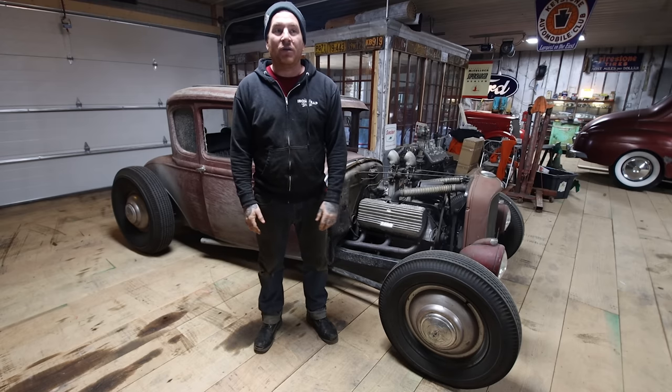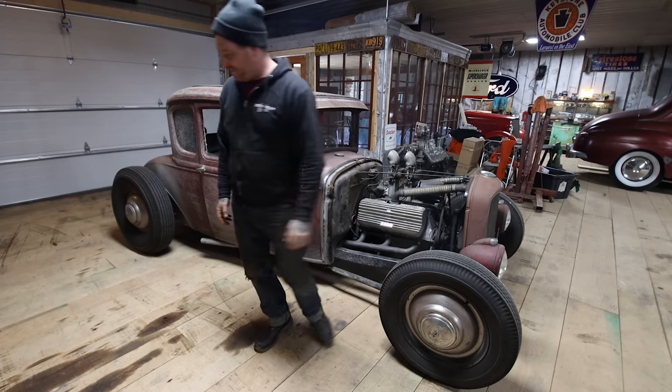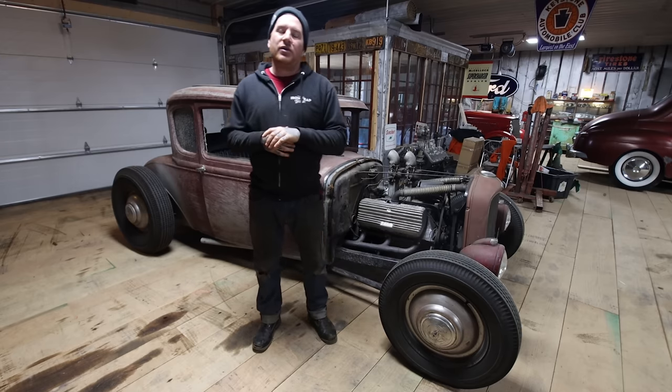As we've gone over the years, we've realized that method is a little sketchy — the body isn't mounted very well, it causes the doors not to shut correctly, and the car has a lot of air leaks. What I chose to do is actually build a floor. I built inner rockers that come up and go into the floor with some box tubing and tie into the original door sill, covered in rubber floor mat. That's a good way to do it so the body doesn't flop around and the car feels solid and safe.